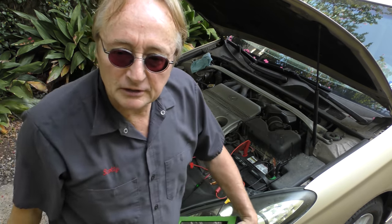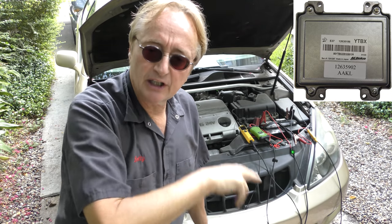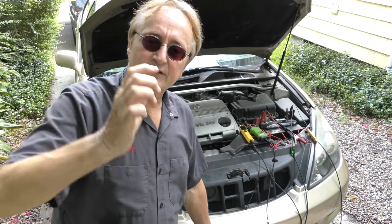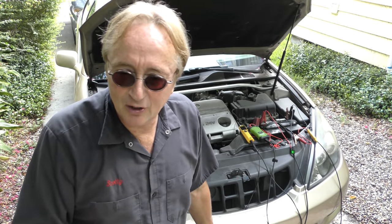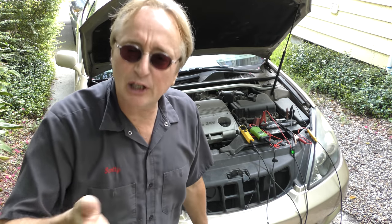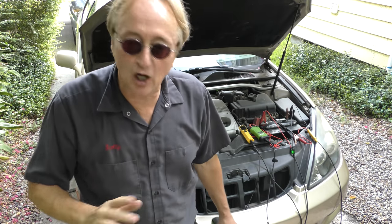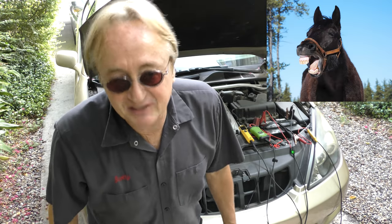power at the computer. If the voltage on your scan tool says a lot less than 5 volts, that means that your ECM isn't processing the system right and it's going to need replacing. It gets expensive. Pray that doesn't happen to you. But again, I've only ever changed one computer on a Lexus, and it was a V8 400 model. It was very old. It's a rarity that they go out in these things, unless the car's wrecked, and then all bets are off because wires can short off and ruin everything. Big reason not to buy a wrecked Lexus.